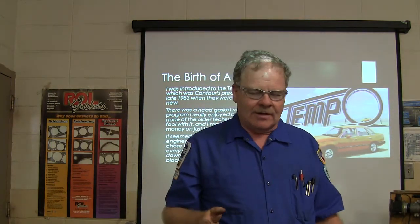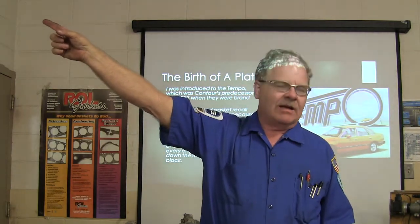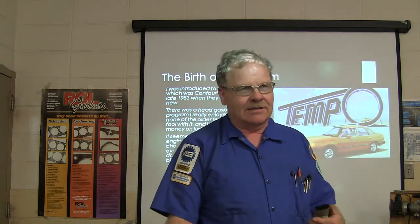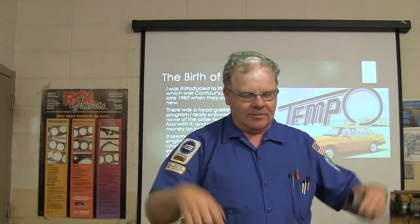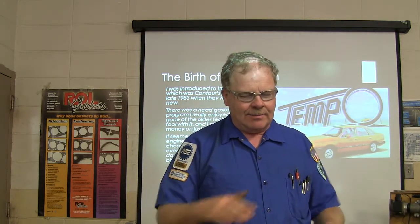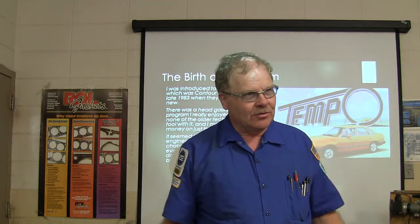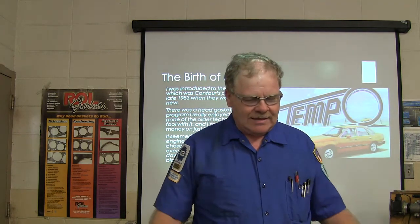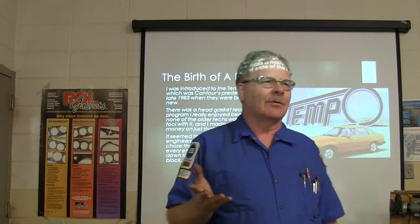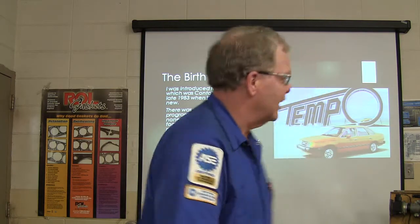Anyway, the long and the short of it was I found out I could do this. We had an engine hoist we got back here that would roll on a trolley. I could roll that over there, unhook that cylinder head, take a brace off the back, pull all the bolts out, hook that chain hoist up to that cylinder head, and raise it up about this far. I could slide that head gasket out of there and feel around under there to make sure it was smooth, because it was nearly a new engine anyway. Put a new head gasket in there, lower it back down, put all the bolts back in, and in 45 minutes I could earn 3.5 hours labor. And I did a bunch of those. They were paying me pretty good money then too.